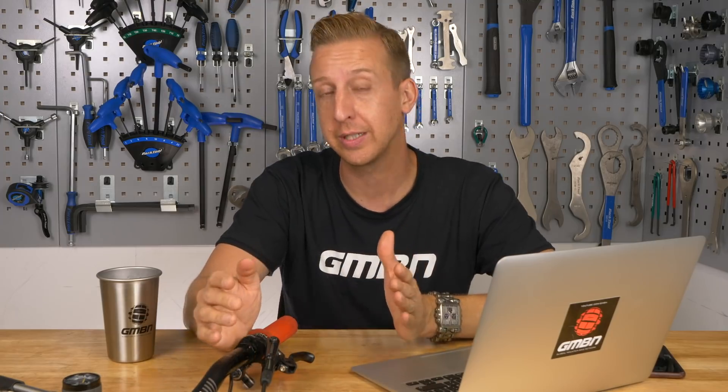Race Face would tell you straight away not to ride those bars. Any scoring on an aluminium bar could lead to catastrophic failure. Although it's only 0.5mm deep, and riding bars with worse scars has happened — even continuing after a crash on extended trips — you really should look at getting those bars changed. Take it to your nearest bike shop for a second opinion, though they'll almost certainly agree. Handlebars are a safety-critical item. Snapping handlebars can cause facial injuries, sternum injuries, or your stem going into your chest. It's time to get those recycled and fit a new pair of bars.